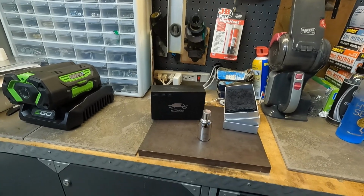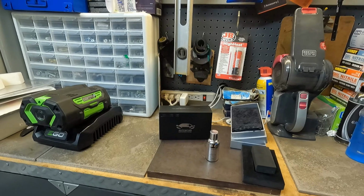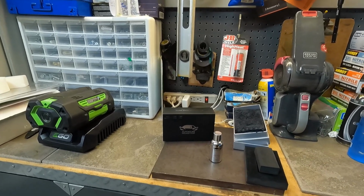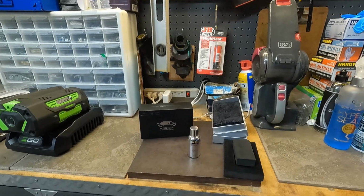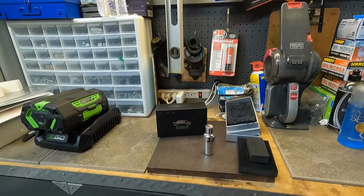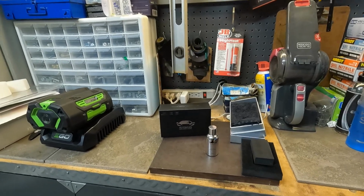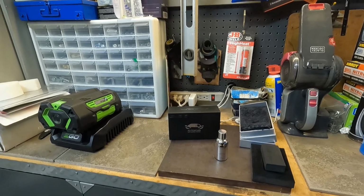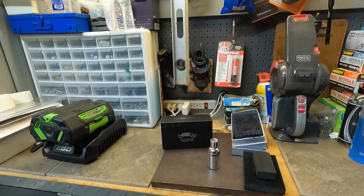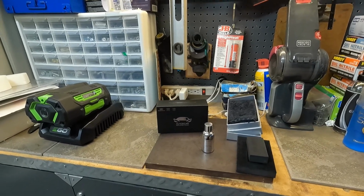What I do want to mention is I'm not going to have long-term testing on the coating. I'm only going to have it for about a month. But the initial hydrophobics look good on the product. It's not the most user-friendly application because you're going to have to play around with the flash times. If you wait too long, it's a little harder to use. If you catch it on time, it's easier to wipe off, but it's still rather tacky, so have multiple towels when you use this.